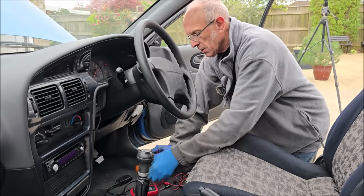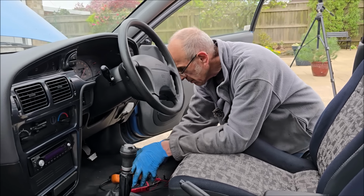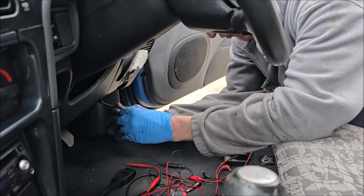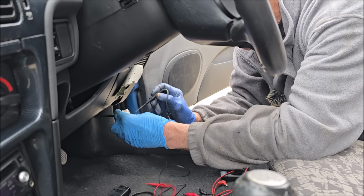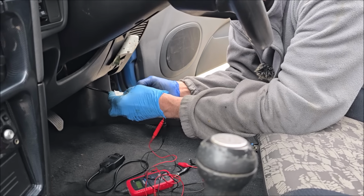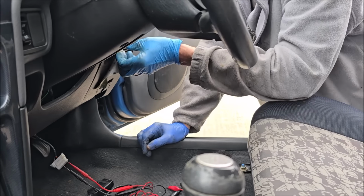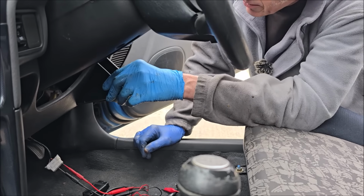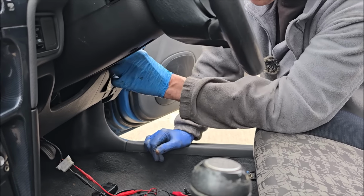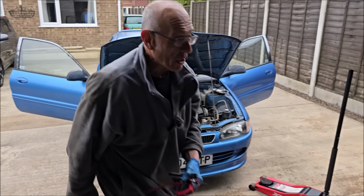Right, so the leads are working. Volts with a line underneath them means it's 12 volts DC. So 4 is ground and 16 is live. We've got no electric to the pin. So where does that come from, John boy? There's the fuse box in here. There is a fuse box under there, yeah. Is it underneath? Underneath, yeah. You know more than I do, son.